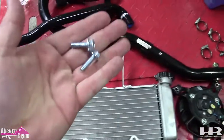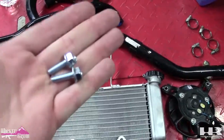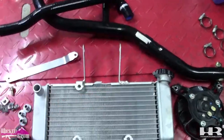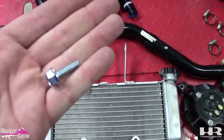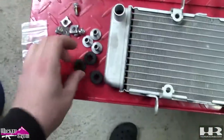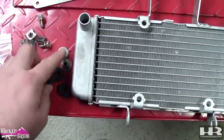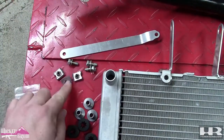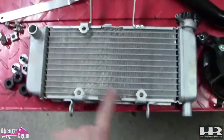For the radiator bolts, you can't use the factory airbox bolts that mount to the frame. They're not long enough. I'll have the thread pitch and the size that I'm using in the description. A side note, they're the same bolts that hold your clutch springs in on your Grom. These three rubbers obviously go in these 3 holes, and these inserts go in there. These 3 bolts and these 3, I don't even know what you call these things, are from the factory setup for these 3 holes.